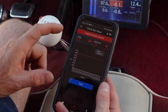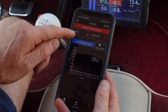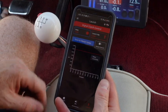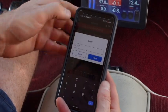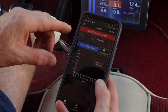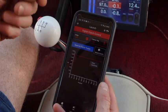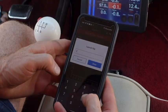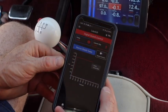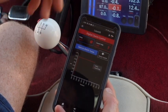Once we've determined the bite point, we're going to go to the launch builder screen, which will carry over the delay we had. Because we're then going to be adding power, we need to add about 30 milliseconds, so 10 plus 30 is 40 milliseconds. Then we want to go test it. The launch slip preset value is 2 seconds — you'll probably want to try it at more like 1 second or three-quarters of a second. We'll set that, then turn the app off to test it; it will save in the controller.